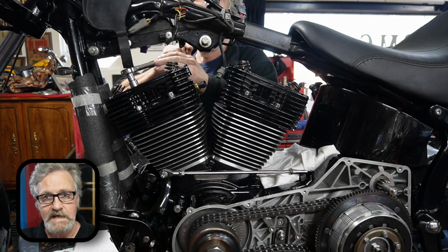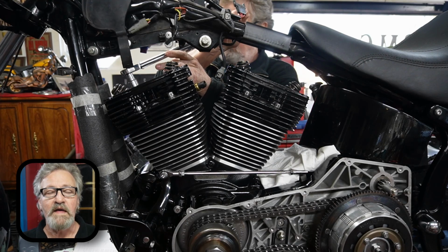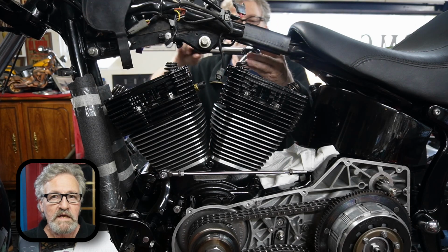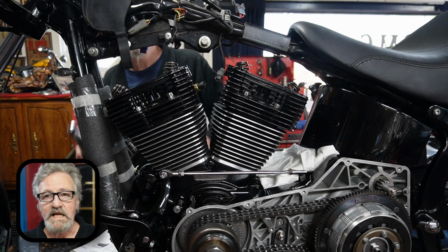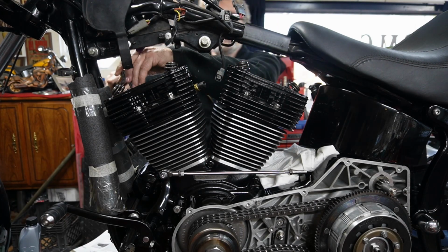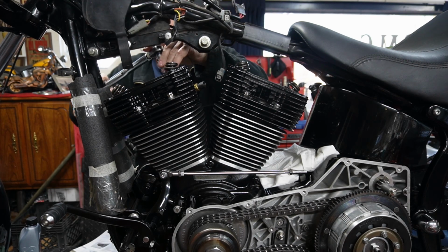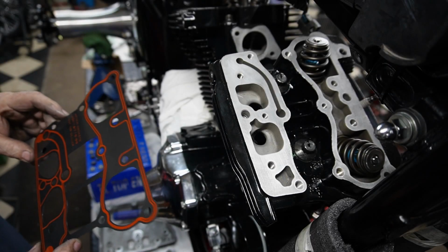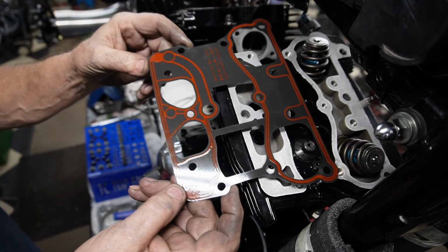So just like that, at 90 degrees. And that'll give you your finishing torque for you to go all the way around. It ends up being about 42 pounds, but that's about the way they like to do it. Oh, just for my own curiosity. Yeah. 42 pounds.